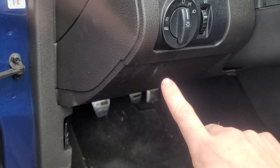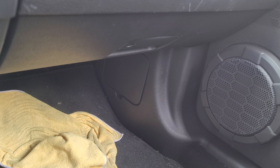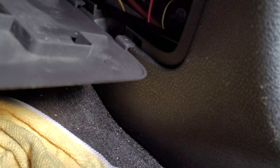The wire goes underneath the dash, and the power for the gauge goes to my cluster fuse. I used one of those piggyback fuse tap wires — you put it in place and add an extra fuse to it. You can see it right there. I can link those in the description in case somebody wants to use the same method. It makes things a lot easier and cleaner.